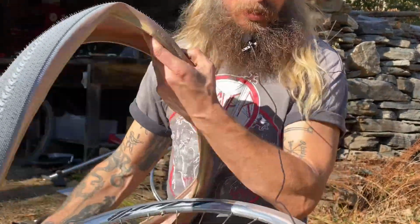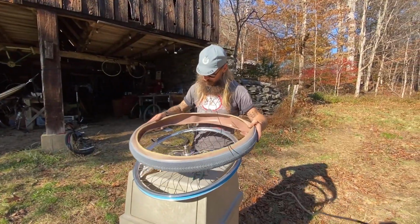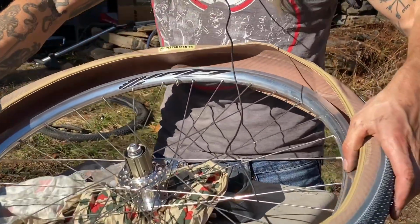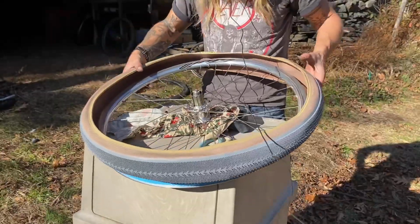Make sure your tire's facing the right way. Ultradynamico is pretty good at that because you just follow the arrows. All right, obviously the arrows are going forward. The next thing you want to do is make sure you line up that label with the valve stem. All right, major faux pas if you don't do that. And you're going to put one bead on at a time.